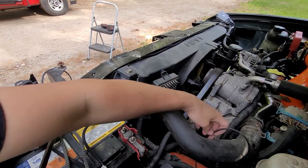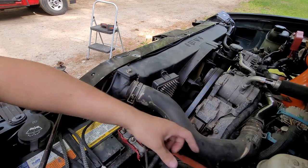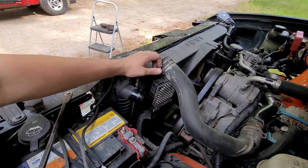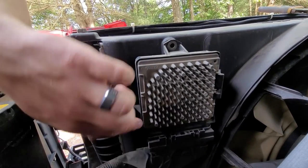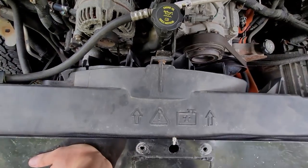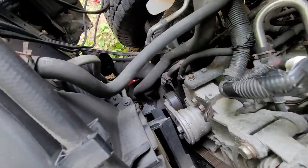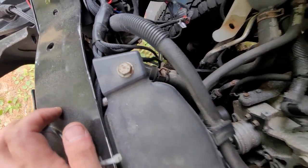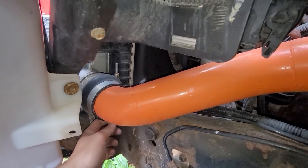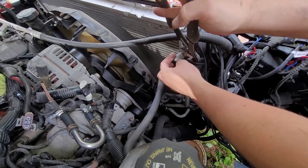Funny thing — I noticed the wire that goes to my switch for my EFI Live got accidentally wrapped around this and has been sitting in there for a long time. We'll hide that wire now. Next, we'll take the TCM out — there's a clip here, here, and on this side. These pop clips just need a screwdriver popped in. Move the TCM to the side. For the fan shroud, we've got two clips on each side, a 13mm bolt here, here, and one more — and this whole thing should pop right out. Then we pop off the hot-side intercooler pipe — 7/16ths nut — and pull that out.